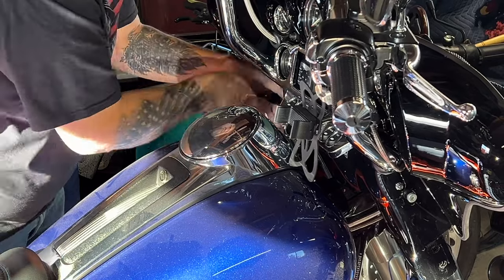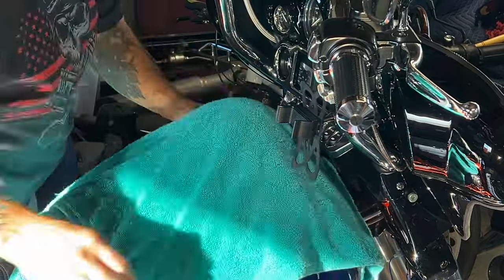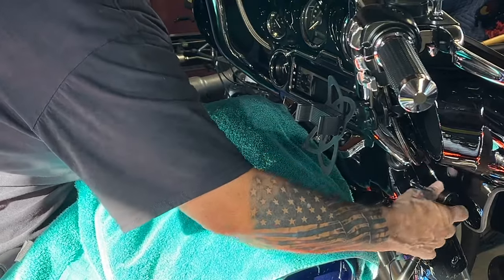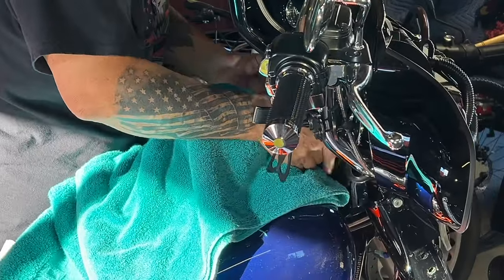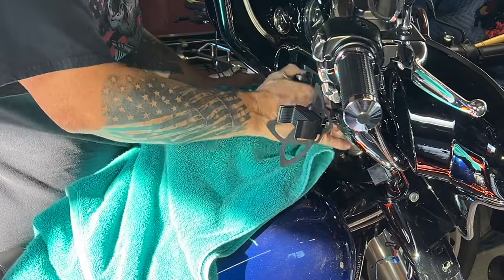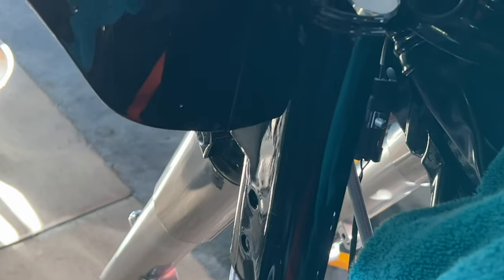It's always best to cover your tank too — you don't want to scratch your tank. I've got a bad habit of not doing it. Once you loosen these side ones off for the ignition cover, they're real easy to come out. Then you want to unplug this guy — these are normally hard to unplug. Now I can actually turn this. You take these side bolts off, the ones that mount to your outer fairing, and you just lift that up and shift it forward.